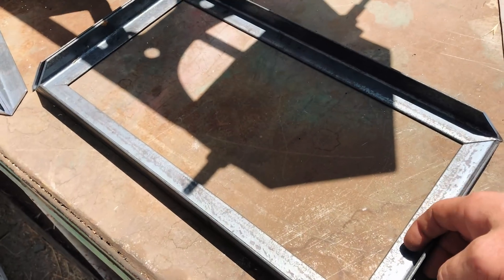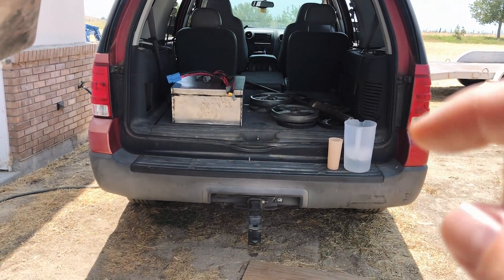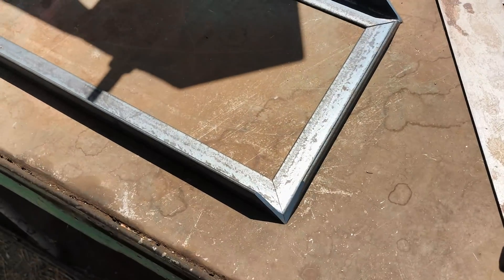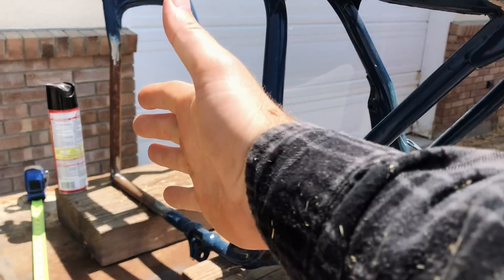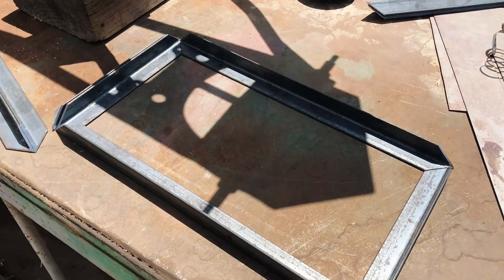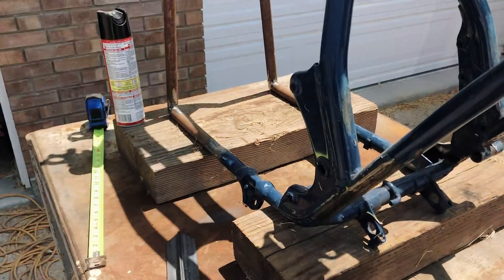I got a frame cut out for going around that battery box. Basically, we're going to have every corner, every edge covered by one of these to let it slide into the bike. And then we'll bolt the other side on. So I'm going to weld these up in a square — make sure it's rectangular — and then we'll just drop it in.